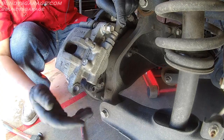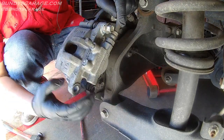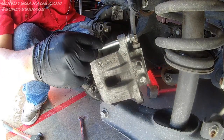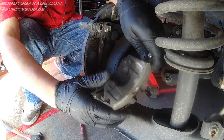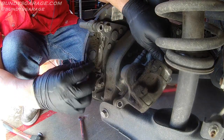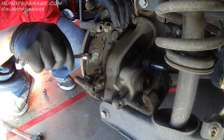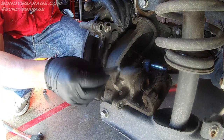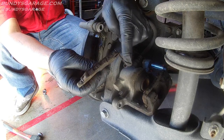I removed the lower bolt — the lower pin — moved it up, and now I'm able to slide this whole assembly out. There's the other pin; this is the pin you're going to grease right here. You can see there's one brake pad here and another one. I'll put a link in the description to a video showing someone who did a hacked job on this.